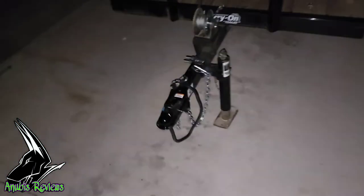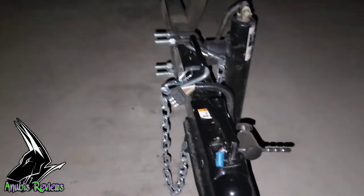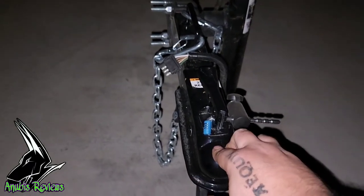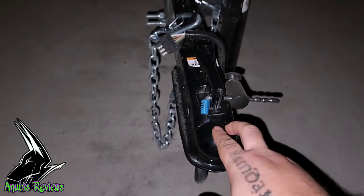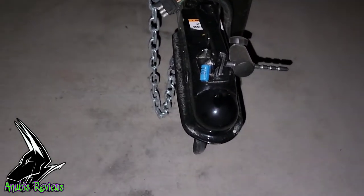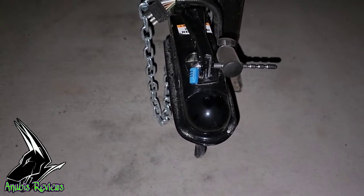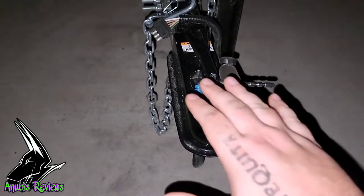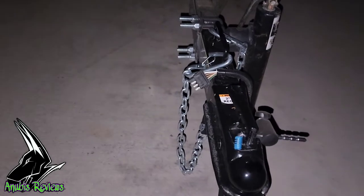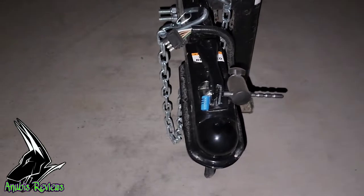Okay, so if the other one is a 9 inch drop and I bring this up 6 inches, then I will level out the trailer with, say, a 3 inch drop, or just a standard height, which will take a lot of strain off of the Jeep when towing, because now it's not weight underneath pushing and torquing the actual tongue. It'll be level.